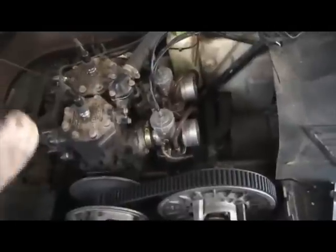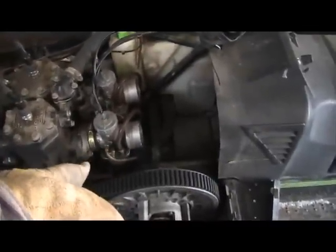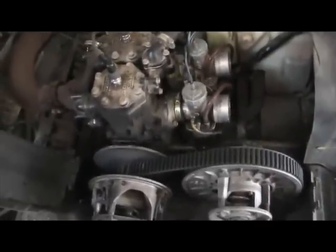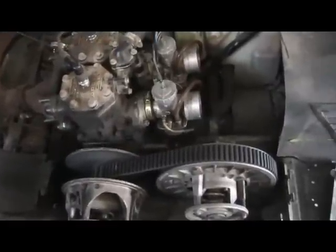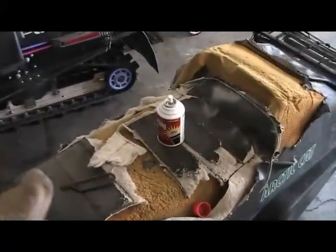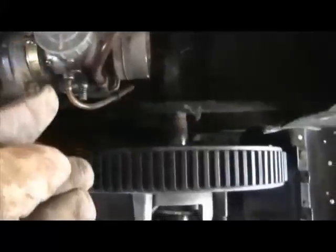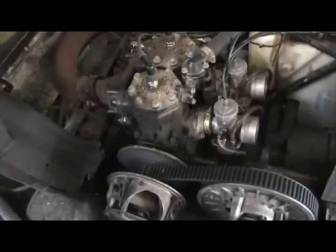You also heard that the thing was idling up really high — I've actually got it idled way down as per the slides there — but you'll notice it idled really high still, right around three grand. That'll be another symptom you'll notice with bad carb boots, crank seals, or a vacuum leak. What you're looking for is you'll spray the starting fluid in those rubber pieces that have a tendency to rot and fall apart over time — seals, carb boots, anywhere around the carb where it may not be sealed, the bottom of the jug — and you're looking for that change in pitch or RPM of the motor.